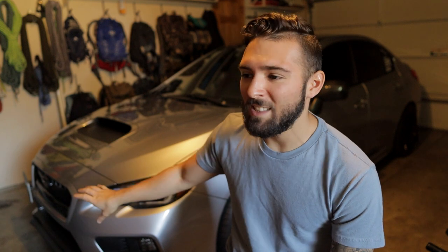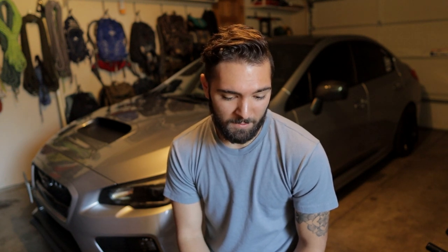That's all I have for you guys today. I know a lot of you are going to ask what is left to do on this car. At this point I'm full bolt-on except for the stock BPV — the bypass valve — and a lot of tuners actually prefer that, so I might stick with that. We might add the Cobb one later. I could do headers, I could do an aftermarket turbo, and those are the only things left I could possibly do. I could do a built block but that's something I'll be doing on a project car, which I haven't talked about yet but is coming soon.